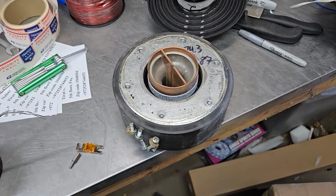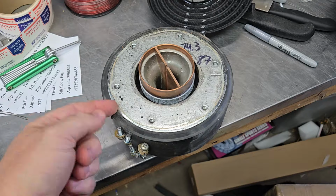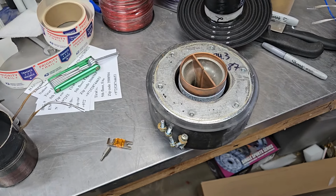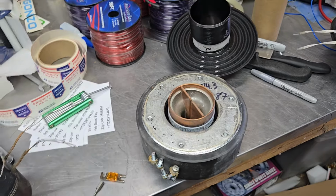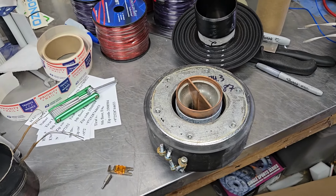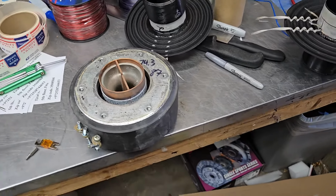Technically, you shouldn't ever get your woofer so hot that it gets up to 500F and dissolves the glue that holds the top plate onto the magnet, but some people do, and I just try to avoid it. It's just part of the business of being in speakers, and as a manufacturer, designer, whatever I am, you just try to avoid it. The real responsibility lies on the end user, on how they use it. So if you abuse it, it's going to get hot. The end.